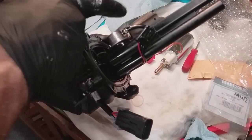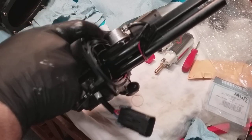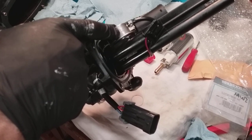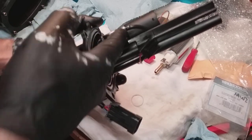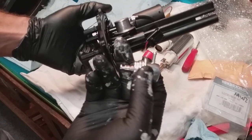See, the cover slides on and goes to this gasket here. So it hangs out just a hair too much right here and hits the cover — you can't line up the screws. You're going to wind up having to buy this regulator OEM. I wouldn't buy aftermarket and/or reuse yours. So now I'm stuck reusing mine. Thought I had all brand new stuff with a new regulator — damn thing doesn't fit.